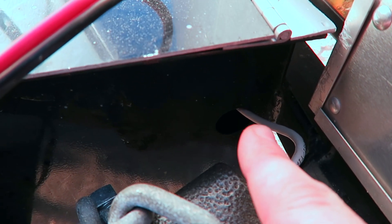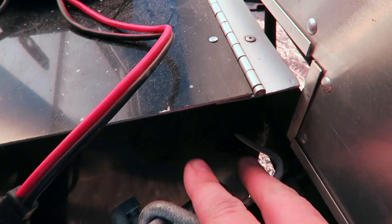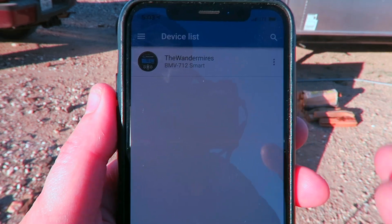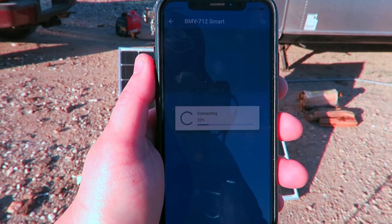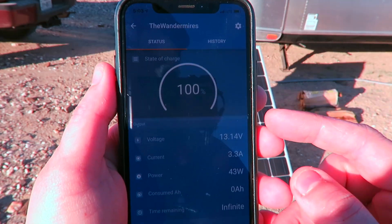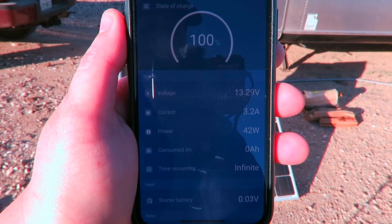Our battery box has a hole that we can bring the Cat5 cable out. Although we installed the shunt in the battery box, we ran the cable into our front bay. I used a cup drill to drill out that hole to install it — it's just a few screws. You can open the Victron Connect app, which is free to download. After you've already set up, you should see your system listed — just click on it and it takes a minute to connect. Then you can see your state of charge, your voltage, and your current status. Play around with that power data and it really helps you dial in on saving electricity.